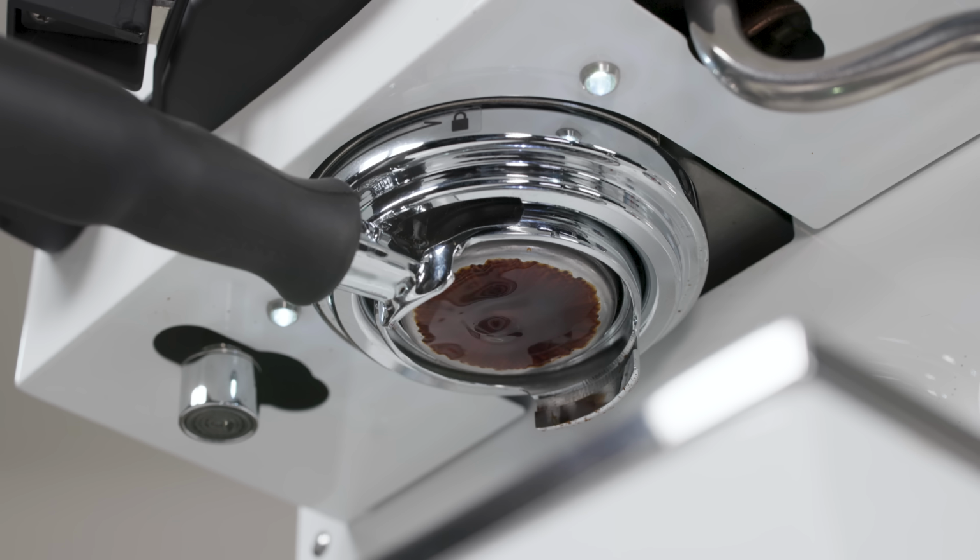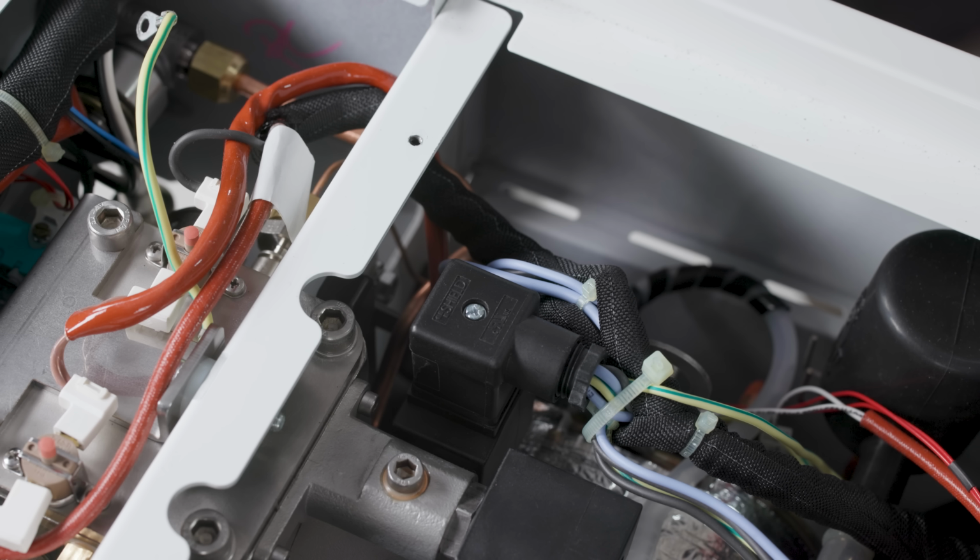What they had was a single solenoid at the brew group, so whenever you did pre-brew and you had it shut off, it would open the solenoid and it would release into the exhaust system the pressure there. You would still have water in the group, but it was depressurized essentially, which could cause unseating of the puck and some other issues. But also a lot of that water that may have some goodies in it is kind of escaping. What they did is they added a second solenoid valve to the brew group.